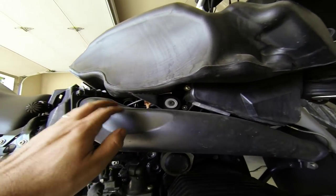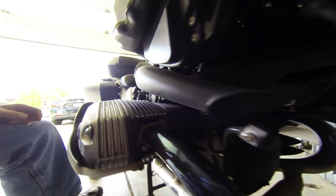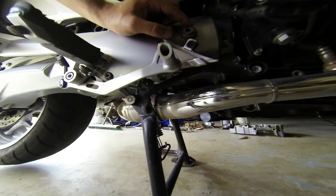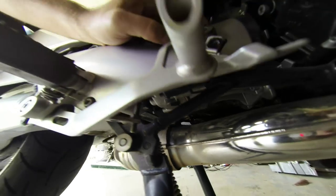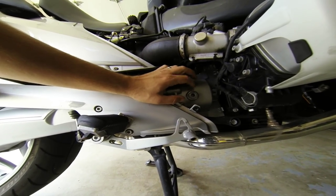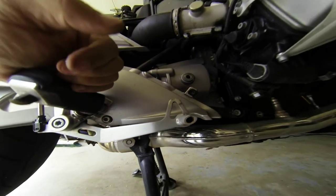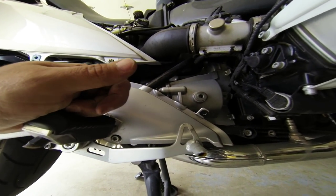Here's a good time — this is your air filter back in here. This is a good time to pop this box off, the snorkel, and make sure your air filter is clean. Here is our fill for the transmission, and there is the drain. The important thing here is: make sure you can unscrew the fill plug before you drain everything. If you can't get it open after you've drained it, you're on a flatbed trucking it to a dealership. So let's make sure it'll open, then we'll drain.